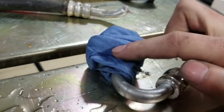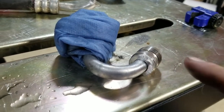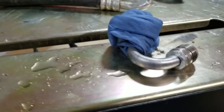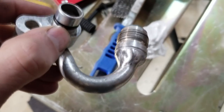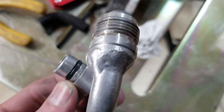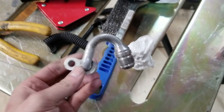What I'm going to try to do now is wrap a wet towel around it just because there's an O-ring and other stuff over here. For some practice I'm just going to try to do a couple dabs, let it cool, rotate it, do a couple more - not have so much heat transfer. This is what I've got and that's what I'm gonna go with. I'm a little worried about pin holes though because there's going to be a pressure line, and that right there is probably going to be a leak. I might go back and booger some more weld on it.